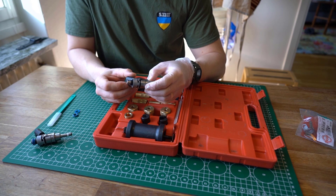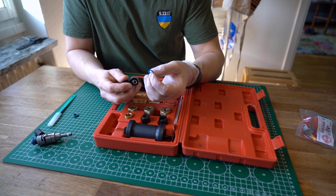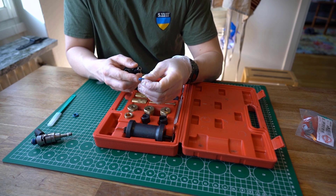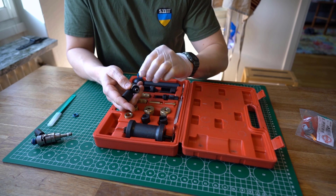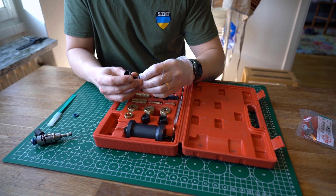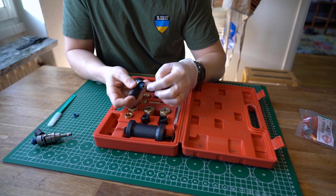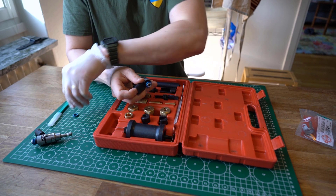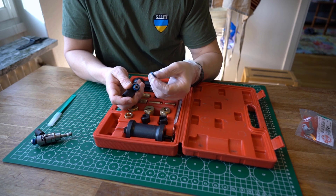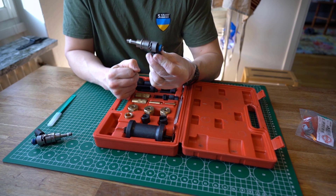What's left now is to install the plastic gasket. The smaller diameter surface goes toward the tip and the larger toward the top — in principle we should be able to just rotate it on. And that's it. Now we can take the o-ring, give it a shake for dust, and it just goes on top. And there we go — that's the injector fully sealed.